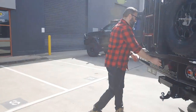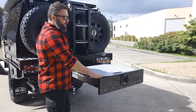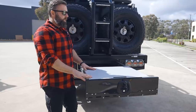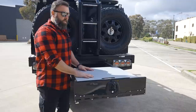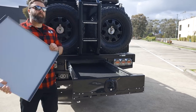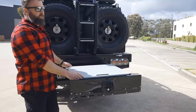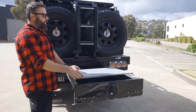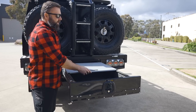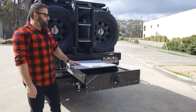Now we're going to take a look at the rear drawer. When we have a tabletop we don't put it on gas struts — we've done it every which way over the years. Sometimes keeping it simple is best, and that's exactly what we've done here. We've got a tabletop that you can move backwards and forwards and take it off to access the whole thing, which is really good for longer gear. The reason we don't run gas struts is that if you have a gas strut mounted lid, the only way you can open it is upward, and if you need to get in, all your gear is just going to slide off. So when you've got stuff on this you can literally get it out of your way. They're awesome as a kitchen bench or even putting a Weber or a barbecue on there — a really great feature.